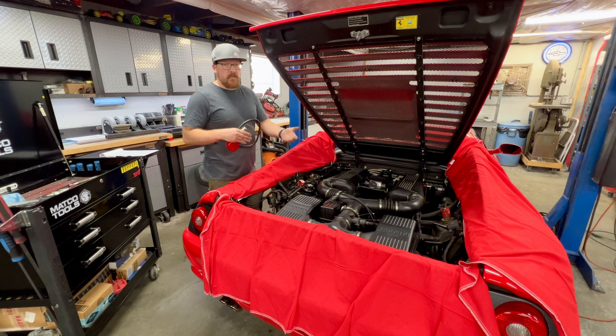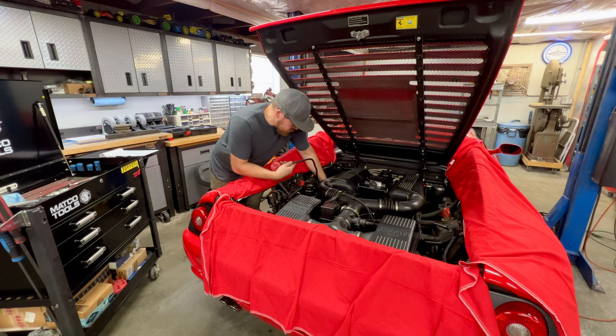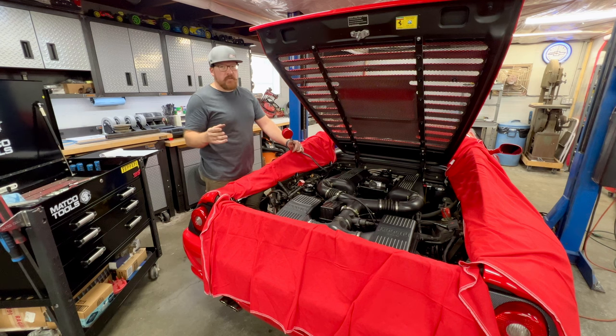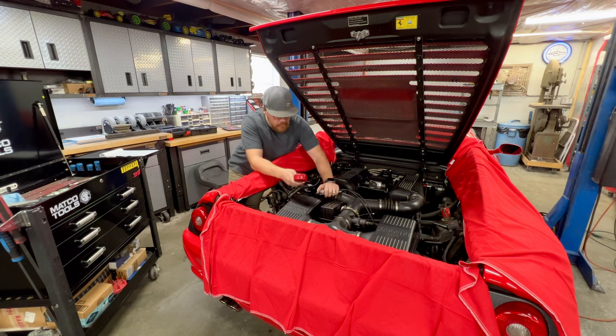If you open the throttles, that eliminates that variable where you're just sucking in atmospheric air with no restriction, and it gives you a much more consistent, realistic reading. It's one thing that's bitten me several times on cars with independent throttle bodies, even cars with carburetors that are really close to the head. It really changes your readings. If you have a car with a single throttle body and a much larger plenum on your intake where it's all shared, it doesn't have as much of an effect, but still it's really good practice to have the throttle wide open and make sure you have no restrictions going into the cylinders, so you're getting an accurate reading on your compression.